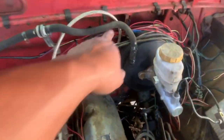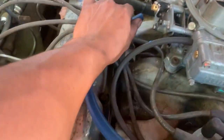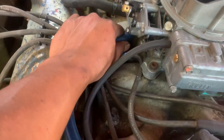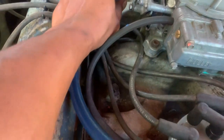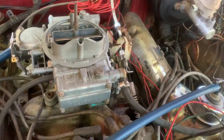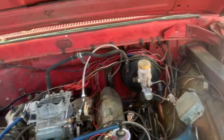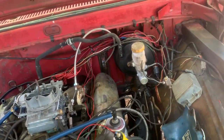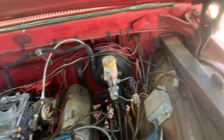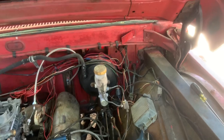The only thing I got left to do is put a little tee right here on the main vacuum port on the carburetor, so I can still use my PCV valve and get the fumes out of the engine. I was hoping that this information can be useful for you — you don't have to spend anything, just go to a salvage yard and get the pedal assembly and brake booster. It's gonna come out way cheaper than buying the new system.